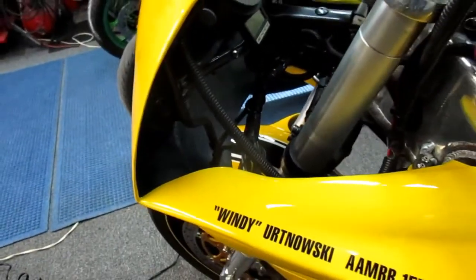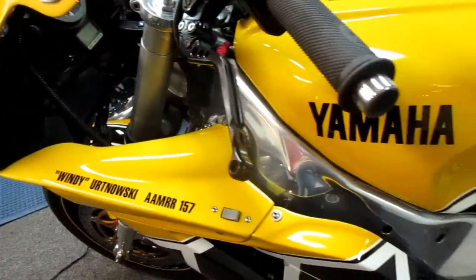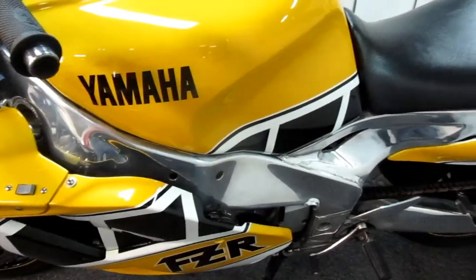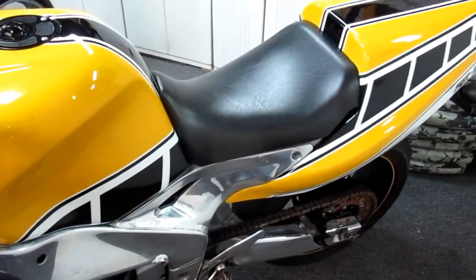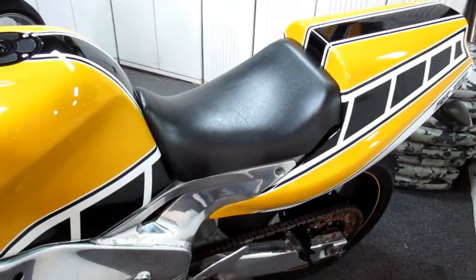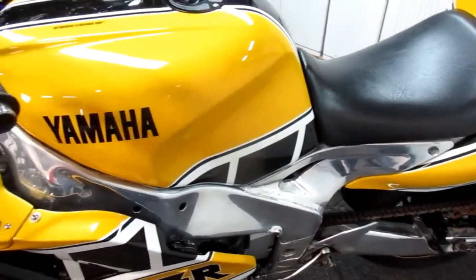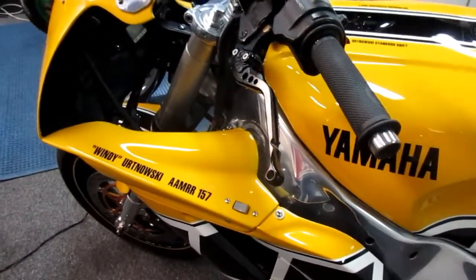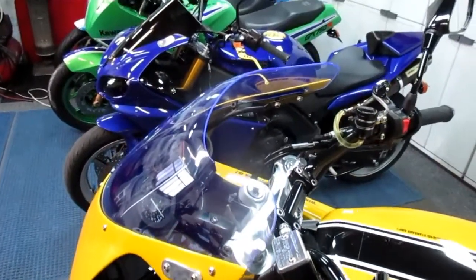Now, even on the FCR restoration, not being able to paint every day is just something I have to work around. What I try to do, and it's good information for people that don't do production work or have never done production work, is you try to use the weather to your advantage. When it's a bright sunny day, you try to have something ready to paint. When it's a rainy day, you try to do work indoors. When it's a cold day, you want to be in the shop all day, not out in the garage. When it's warm, you can spend some time out in the garage, disassembling bikes or doing whatever.